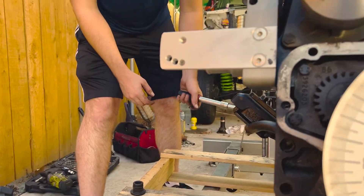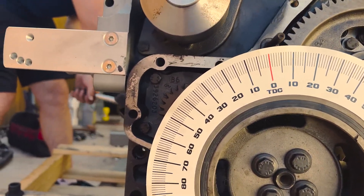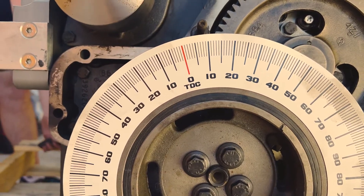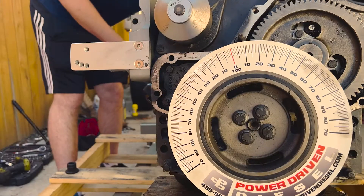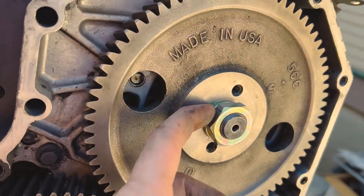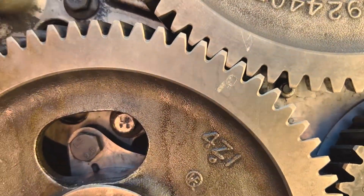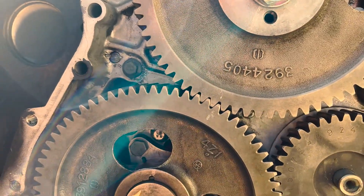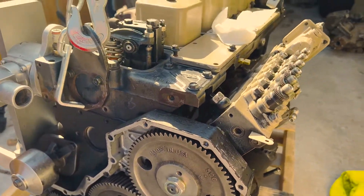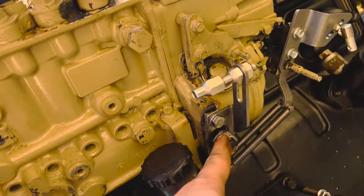Counting up through the degrees — two degrees, seven, ten — right there. The gear for the p-pump is back on with the washer, cross washer, and 30mm nut. We made a mark where top dead center should be and indexed it with the correct mark on the cam. We took the crankshaft pulley off, then put the timing cover on. Make sure you tighten it with an impact wrench — not a torque wrench or regular socket — otherwise you'll change your p-pump timing. Also make sure you have your plastic flag out of there.